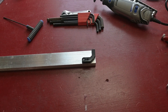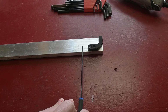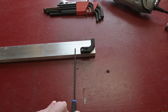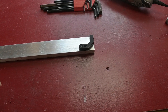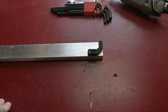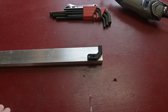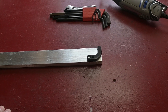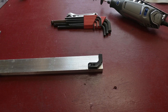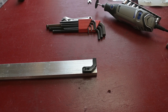Over here I have the original anti-rotation arm. I'm going to extend it down about a half inch — keeping the same geometry other than the length — and redo the hole. That should give enough distance to drop the front of the tracks down and get it pretty close to horizontal. That may also change the leverage point a bit and have a better effect on compressing those shocks, though it might go the other way too. Off to the saw and the mill to get started.